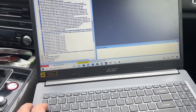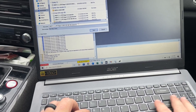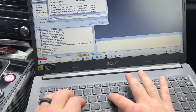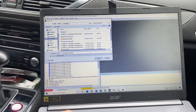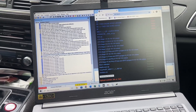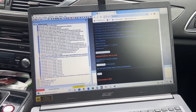Now we're going to click Save As. All we're going to do is add TCU to the end of the filename. You can't make these file names too long — there is a character limit. So we save that, then come back over to the DynoSpectrum tab and upload the file — choose file, TCU modified bin, send.